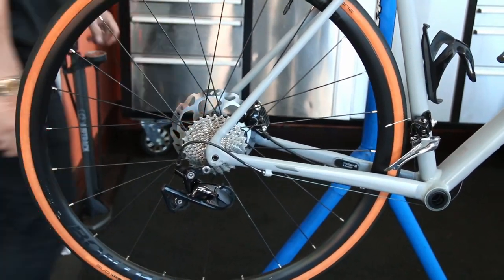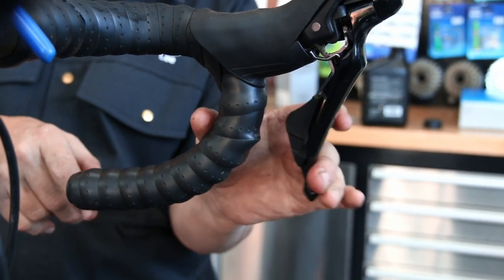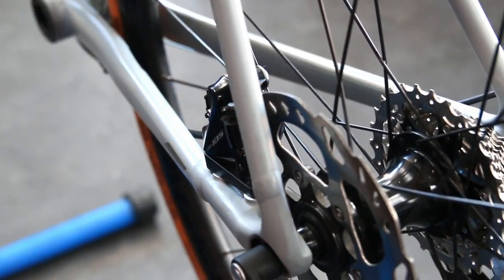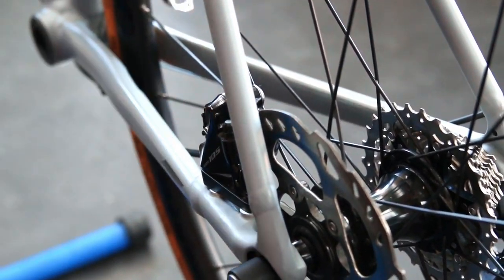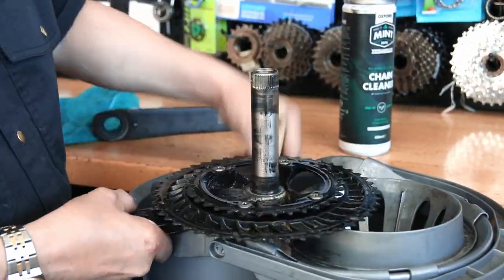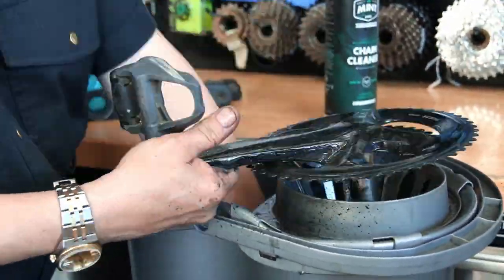Once the wheel is back in, I'm just greasing the axle with a little grease and copper slip. Now you can see we've got a full finger's width — half an inch — compared with touching the handlebars originally. A little bit of copper slip on this brake pad pivot point stops it sticking in the future.